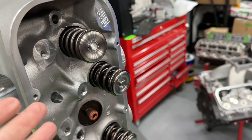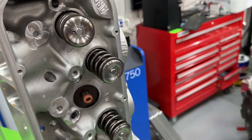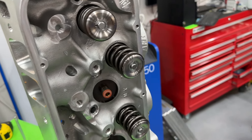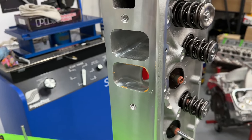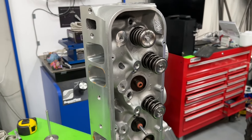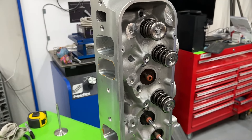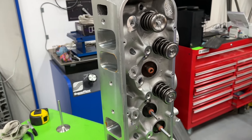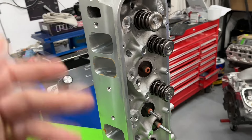Because right now it's all 1.7 rockers, I'm going to buy a new intake rocker that's 1.8 so I can switch and put a 1.8 on there — these heads really do move a lot of air. I don't know exactly when this is going to come up because I want to test the oil pump stuff first, change to the gear rotor, see what that does, then the better oil pan, and then maybe these heads.